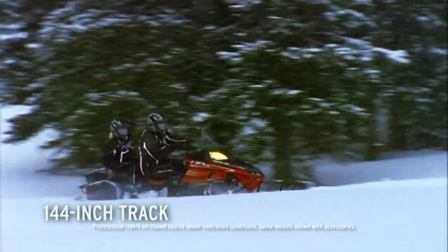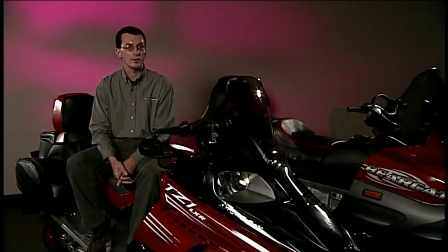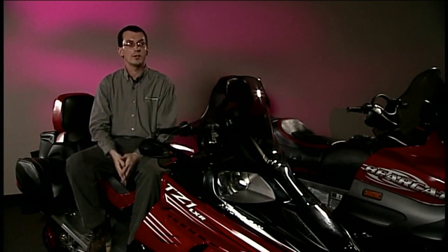We took a Jaguar and essentially you take the tunnel and just lengthen it out to a longer 144-inch is where we're at now with our track lengths. It also resulted in tipping the tunnel slightly. If you can picture the drive axle, basically what we did is took the tunnel from maybe this type of angle to this, flattened it out, which brought the rear passenger down to a more comfortable level and not had the rear passenger, you know, sitting way up in the air.